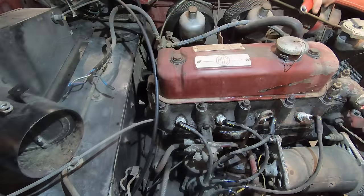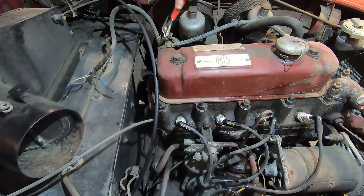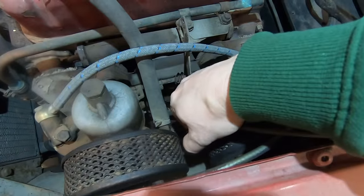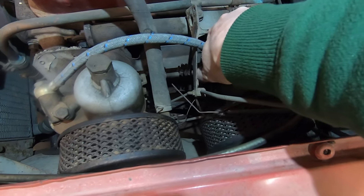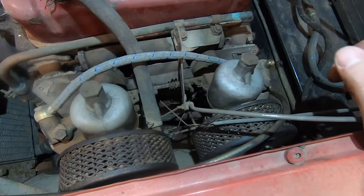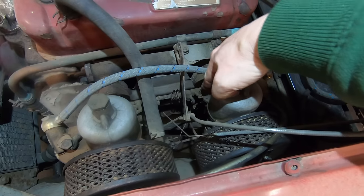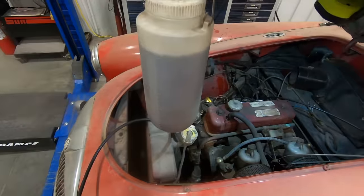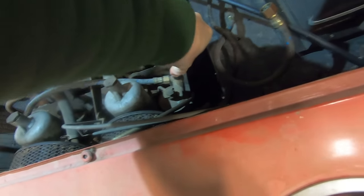The last component we need to get it running is fuel, so I'm going to disconnect the fuel input here and hook a fuel hose directly up to this from a canister. It looks like the choke is still connected, but the throttle is not connected to anything, and the two carburetors are no longer connected together — the little bolt that locks them together has fallen out and is missing. That's okay though; I can adjust both carburetors' idle settings with the screws. We should still be able to start this thing.